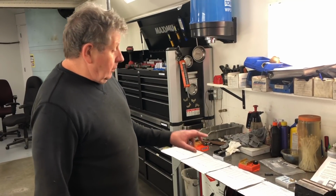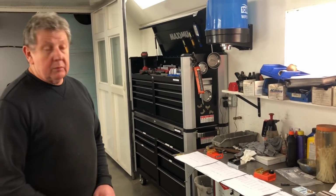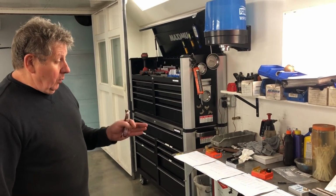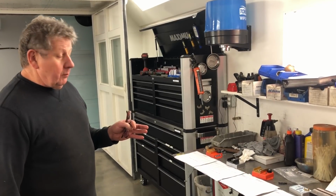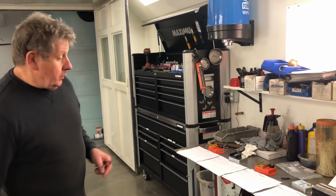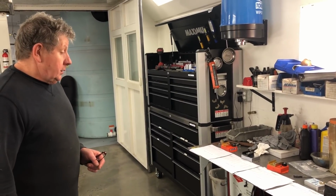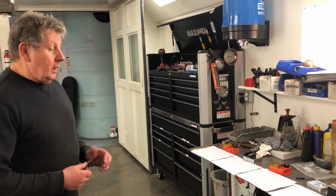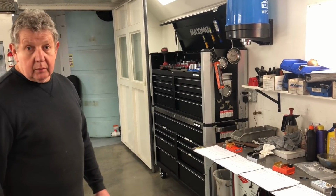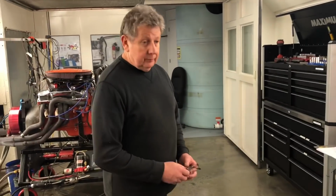And I should mention that both of these boxes come with rev limiters on them, so you can adjust the rev limit. Apparently the FBO box does not work well with extremely high RPM, but up and through 7,000 it's fine. On this engine it was perfectly fine. The Revator I don't think has any of those issues, and I should mention that the Revators you can't get right now, but we fully expect that they're going to be available again, and we'll be testing when they do come out again. Okay, right on.